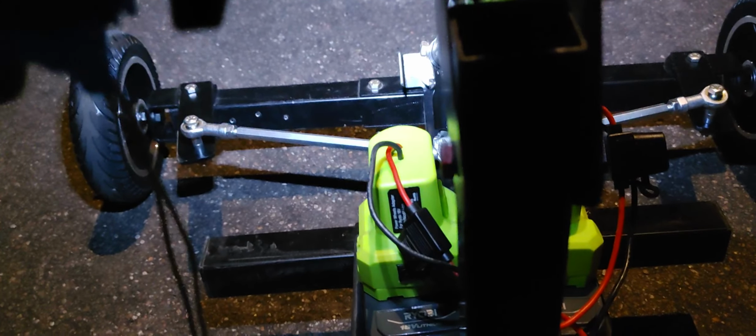It's because this is a very low profile go-kart, having wheels that are 200 millimeters in diameter by 2 inches. These are brand new wheels, aluminum wheels that I just got. The pattern of the tire matches the same pattern on these motors here that are also part of the wheel. These brushless motors came off a hoverboard. So yeah, it's running really sweet.